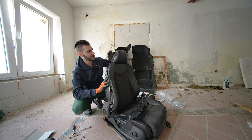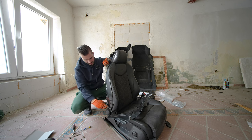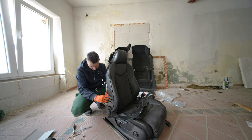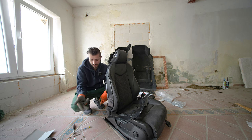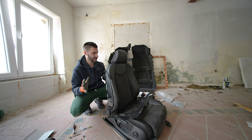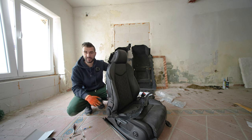Once it's in the slot, you need to slide the whole trim piece upwards a bit, and then slide it over this side piece, and then align it with the screw holes, and then just screw it in with the two screws that we undid to get it off, and that's it. And then just yank the rear cover on, and basically you're done.